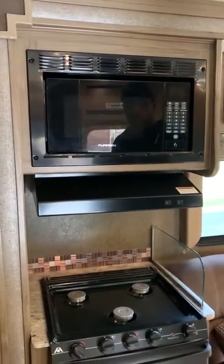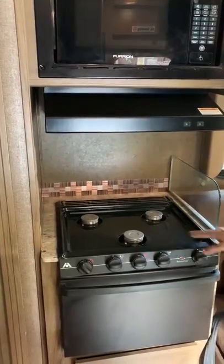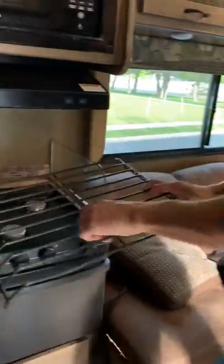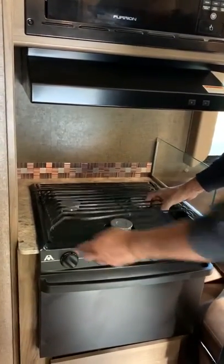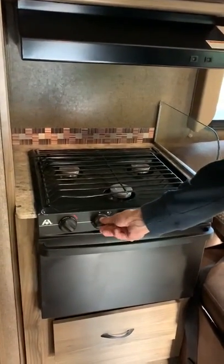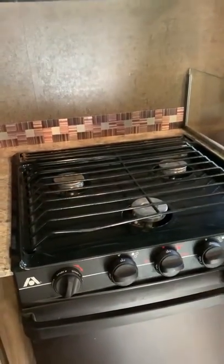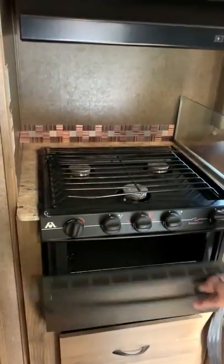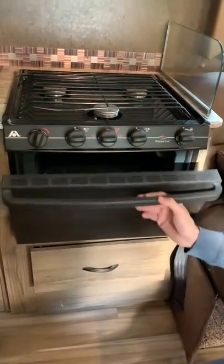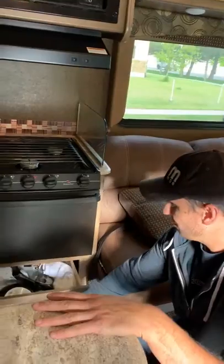Microwave works just like a house microwave. The cooktop — I've taken the top off of it because it rattles; it's missing some rubber feet and I just store it underneath there. The burner works really well; you can just kick it on. Now the stove — I've used it just once and it wasn't great. You have to turn on the pilot and light it with a lighter, and we have lighters in here. The one time I used it, it burned the metal on the inside while the outside was cold. It won't win any awards but it'll still do the job.